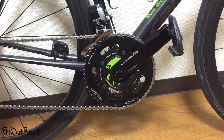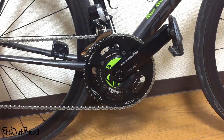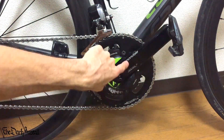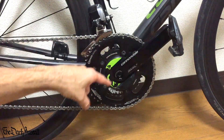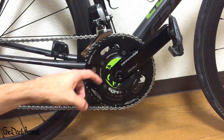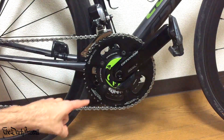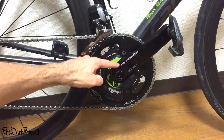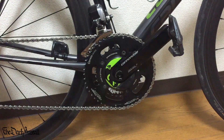These cranks are Cannondale's top of the line race cranks for road, and I believe they're also used on mountain bike as well. There are two separate arms and a separate axle. Then there's a sort of compression system thing which sits on the non-drive side, which I'll explain later. The cranks are screwed down on each side. The axle goes through and the arm sits on the axle with a spline. The chain ring system is attached with a lock ring on the back and has a proprietary spline shape which slots onto the drive side crank arm. The non-drive side doesn't have that, of course.